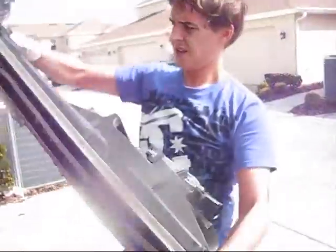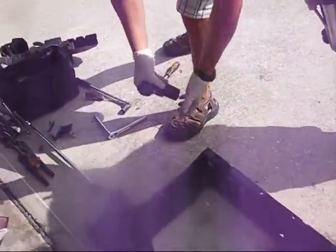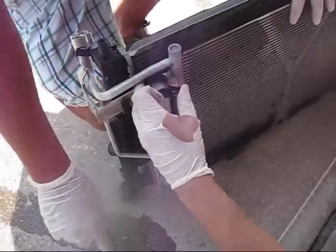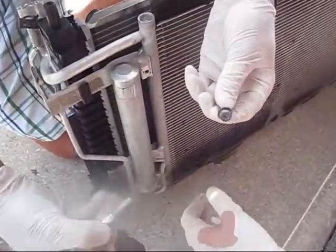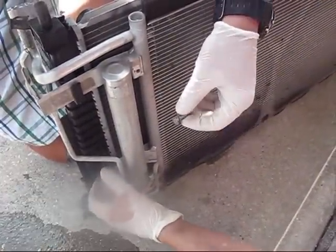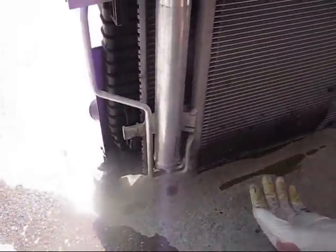When you remove the tool on top you can easily remove the whole radiator — squeeze it out together with the condenser. Then remove this bolt. Don't try to use a screwdriver or the thread will be gone; use a 10 millimeter socket and you'll be able to remove the bolt.